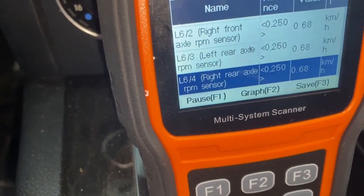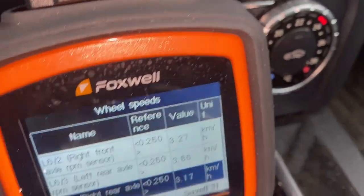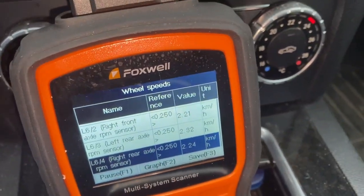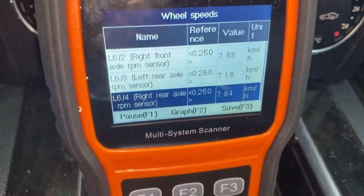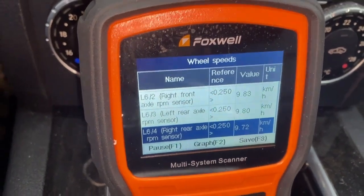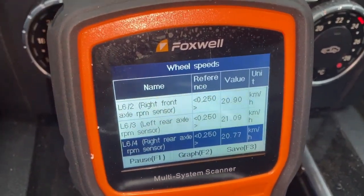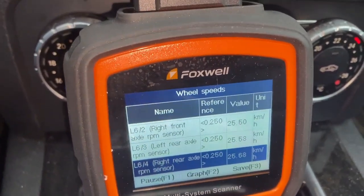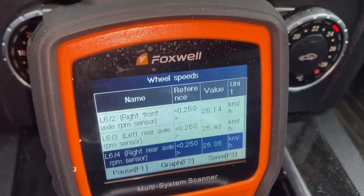It's still quite off from the others — you can see it moving at a different rate. The sensor is likely bad. Going to wait until I drive first. Yeah, it's way off the others. Going in a straight line — yeah, way off. It catches up at times and then backs off and advances over them, so the speed sensor is bad. I've got to order one and replace it.